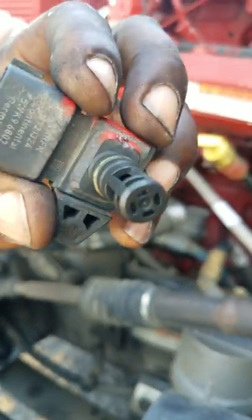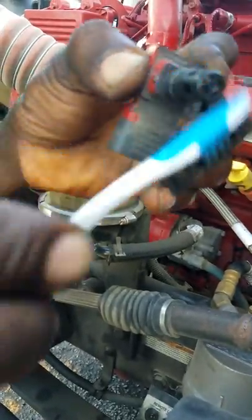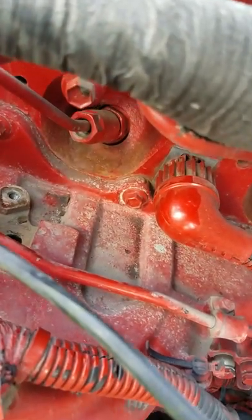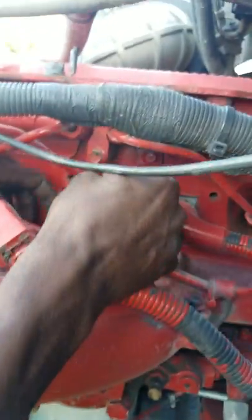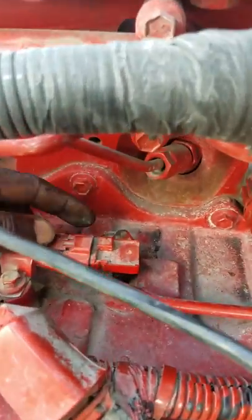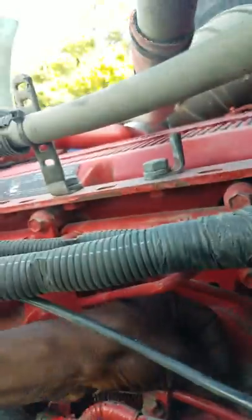It must look pretty good — okay, that's perfect right here. So what I'm gonna do now is just put it back, the sensor, into that little hole right here. Plug it back up right here — that's the plug. Plug it up and push it back into that hole right here. Pretty simple, pretty easy. There's an O-ring on it — you gotta be careful with the O-ring. You don't want to damage that O-ring. This is the bolt you use.